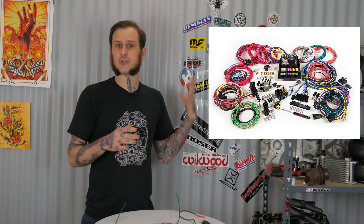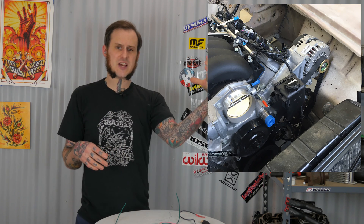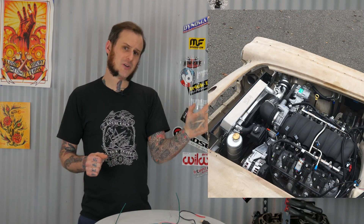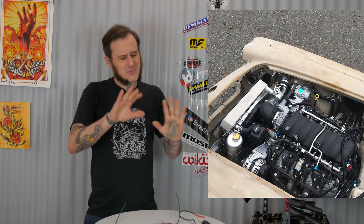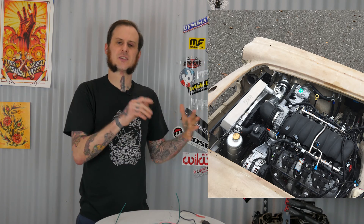A wire I think is just far too small on that chart is the alternator wire — it lists the charging wire at 10 gauge. Something like an American AutoWire kit comes with an 8 gauge wire for your charging wire, and personally I think even that is too small. I run a minimum of 6 gauge, or 4 or 2 gauge depending on the size of the alternator. For example, the LS3 engine in the '58 Corvette I recently wired — the alternator is on the left side of the engine, the wire has to travel under the motor to the battery terminal on the starter, and it's a 140-amp alternator. I'd rather give it a much bigger pipe so it can easily flow that power and constantly charge nicely.